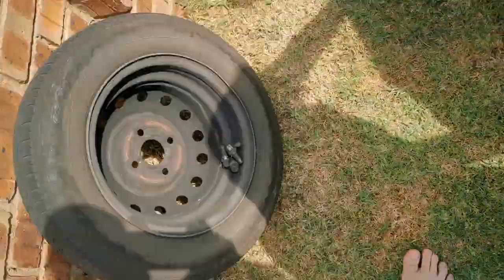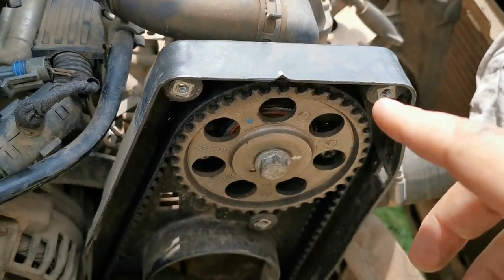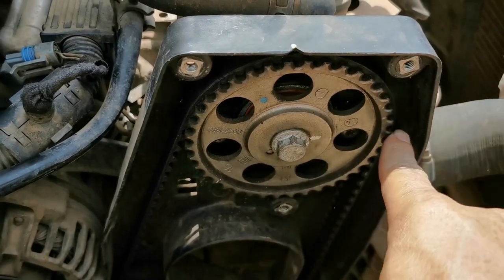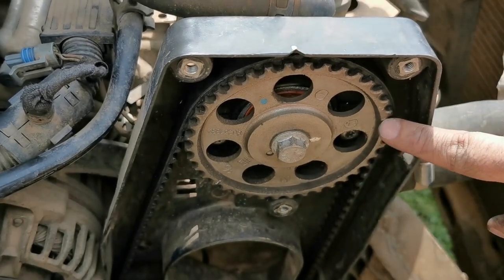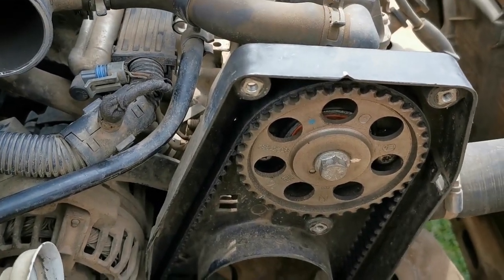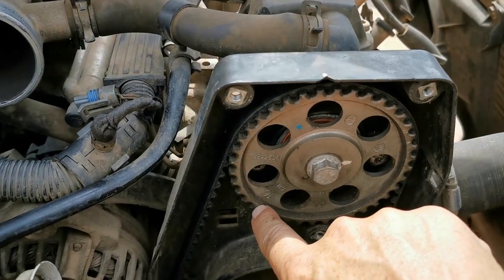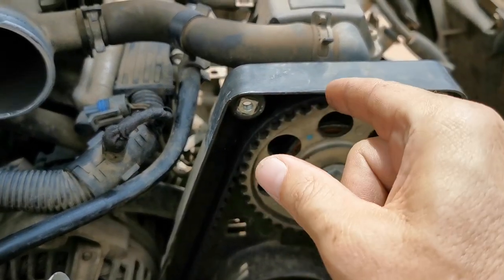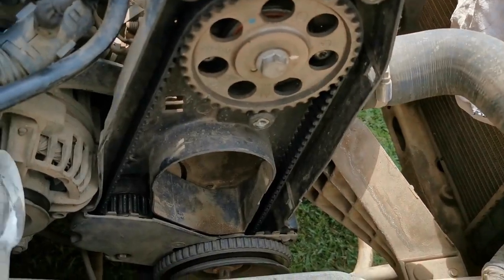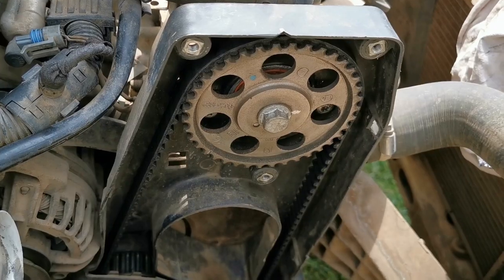So our next step would be just to put the car on its timing marks. Now, timing works like this. You've got the notch on top, and also there's a pin on the tip of your gear, and there's another one. So what you do now is you're going to take that size socket for the bottom one. You're going to turn it so that this notch is right at the top of this notch, and then we're not going to touch it again. It's going to stay where it is. It's just to give you a landmark so that if you accidentally move something when putting the cam belt back, you don't lose your timing.